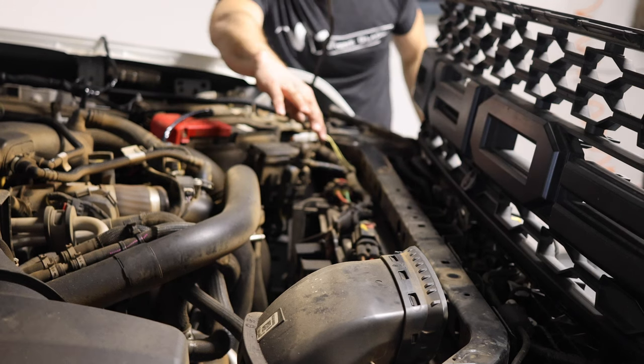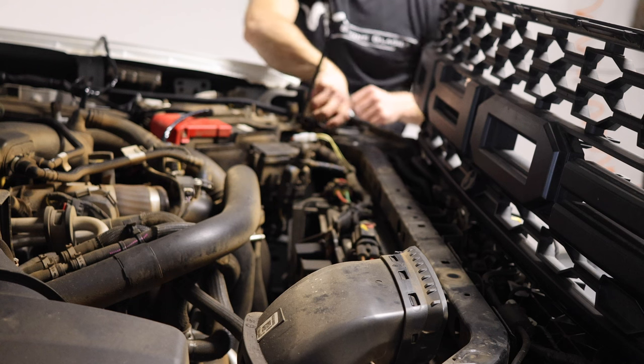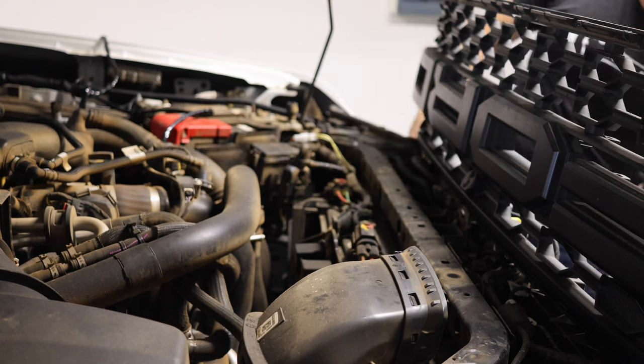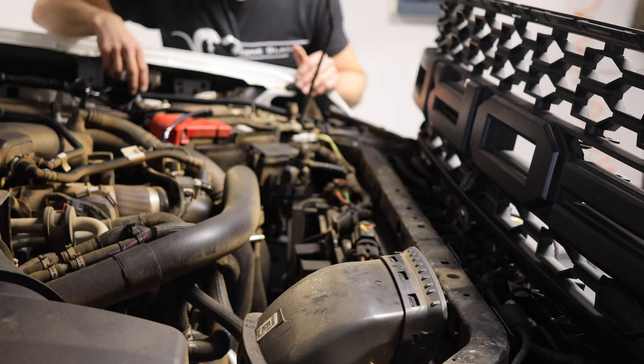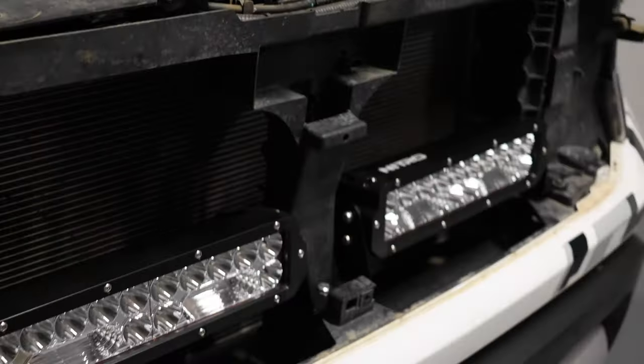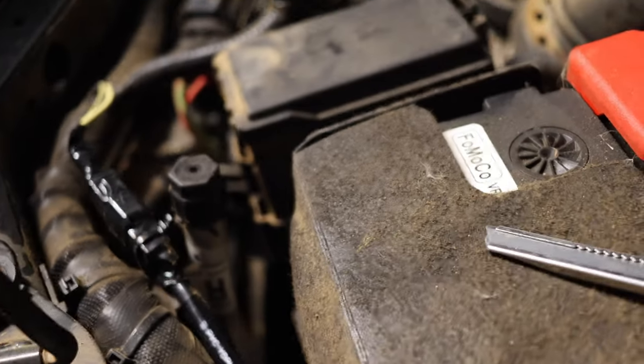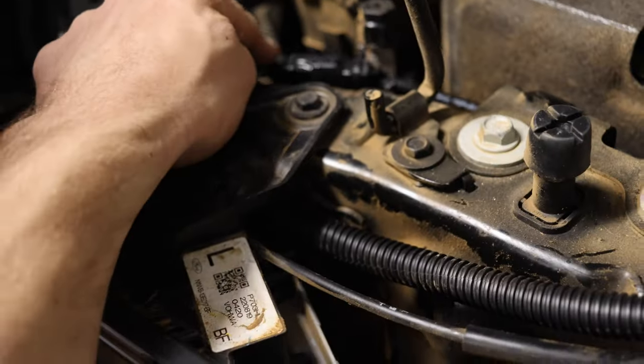I've changed my routing plan a little bit because I was worried going through there might touch the radiator. So I've come from this relay underneath this — I just loosened this guy up a little bit over here and down there, and it looks pretty neat from the front. I'm just going to do another quick test before we start hiding all the wires. I've relatively tidied up what I can. Plenty of cable ties used — you can see none of the wiring from the front here. So the grill is going to go back on now. I moved that terminal from the back there and put a new bolt and a washer here. I've hidden it underneath this panel, and everything is running neatly along like this.